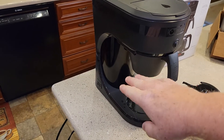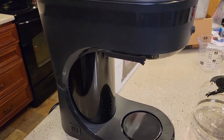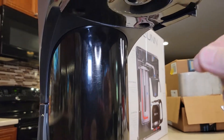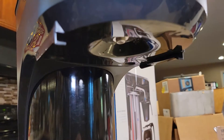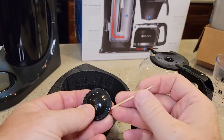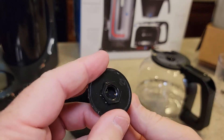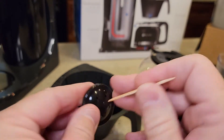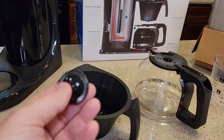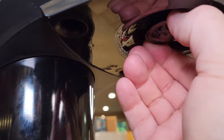It's been soaking for two hours. It's nice and cooled down, nothing's going to be hot. Now we want to take this brew nozzle off. Up underneath here, if we look at this brew nozzle, we can take this brew head off — it just screws off, and that's where the hot water comes out. It's got these little holes. Get a toothpick and clean out these holes. The toothpick won't go all the way through, but you can see it comes through. You will get some calcium buildup on these, so make sure they're nice and clean, all of them, all the way around. If you live in a high-altitude setting, they will give you a different brew nozzle. Now you're going to screw it back on — it goes on real easy. Don't force it, don't cross-thread it. Just screw it and give it a little snug fit.